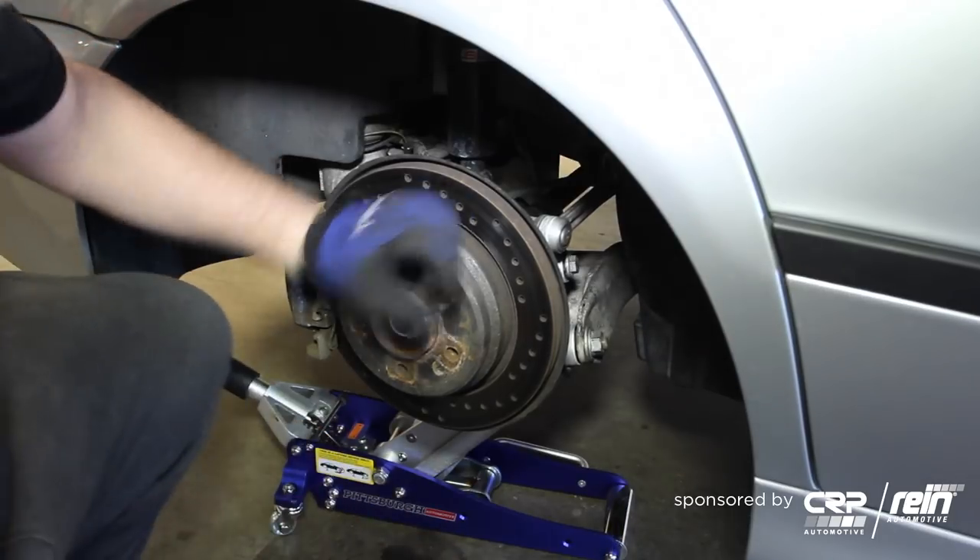Alright, that's how you replace the rear ball joint on an E39 5 Series. This process is going to be fairly similar on the E38, E60, and pretty much any newer BMW including the E90. If you have weird tire wear from the rear or notice the handling isn't quite there — like the rear end wobbling back and forth — it's probably that ball joint. As always, if you have any questions please feel free to give us a call at 877-634-0063. Thanks for watching.